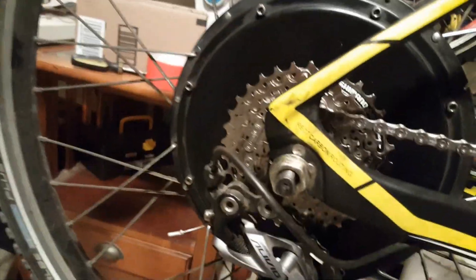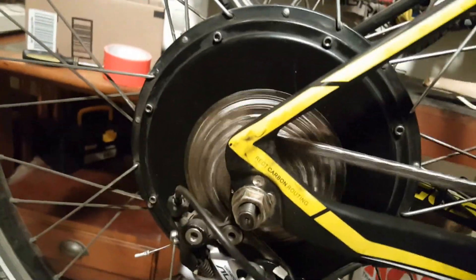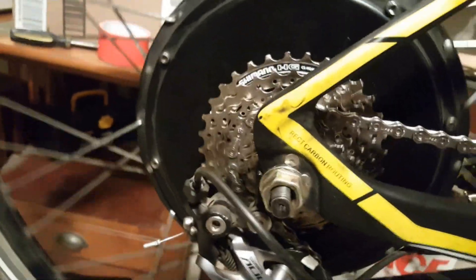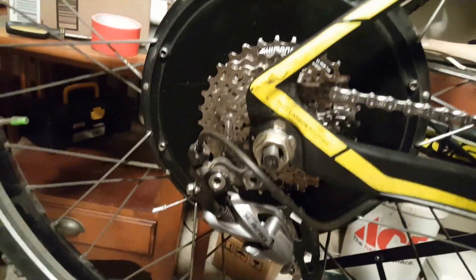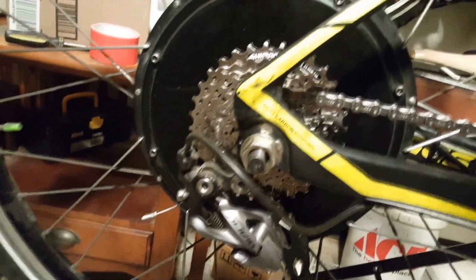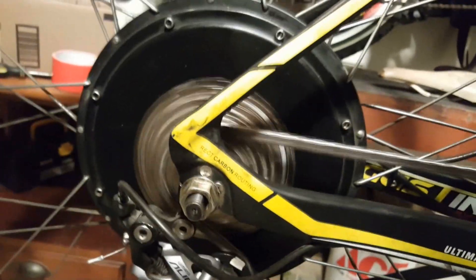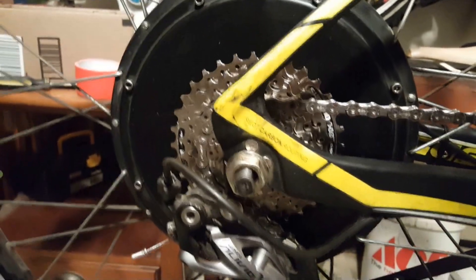I've installed the chain — it's perfect, same size as the old one. I've got the new cassette on here, and look at that, everything's working like a charm — brand new. So I took a 10,000 mile chain and cassette off and replaced it with a brand new one, so we're good to go. I just have to adjust the brakes, attach this, get the motor back running, and I'm good to go. So that was a great, every-year-or-so kind of maintenance — replacing your drivetrain is such an important part of the bike. Anyway, I'm super happy, it looks great and works great, and I'll see you next time.